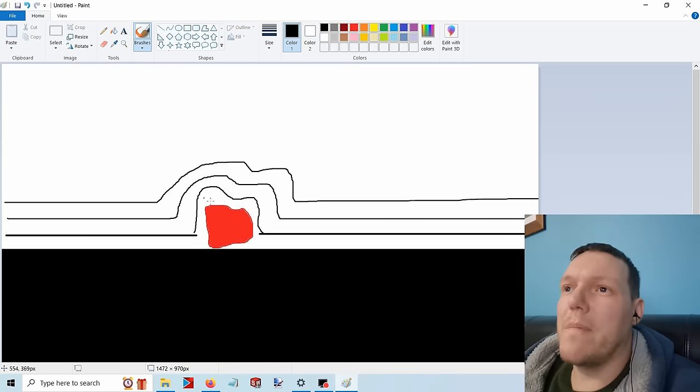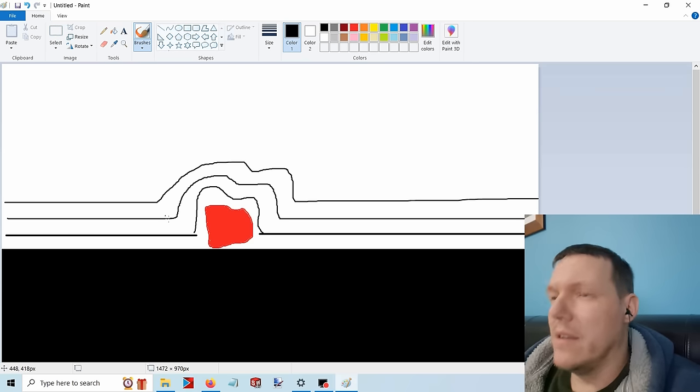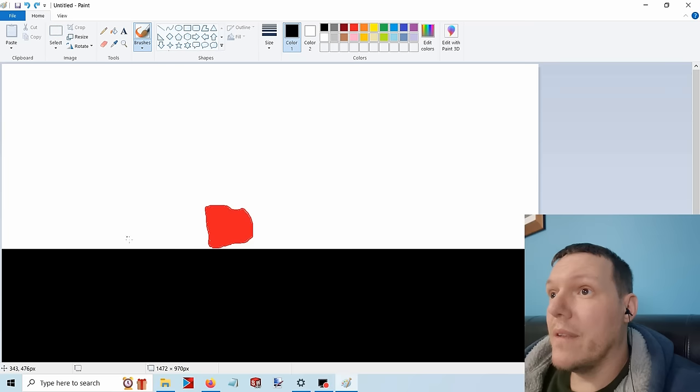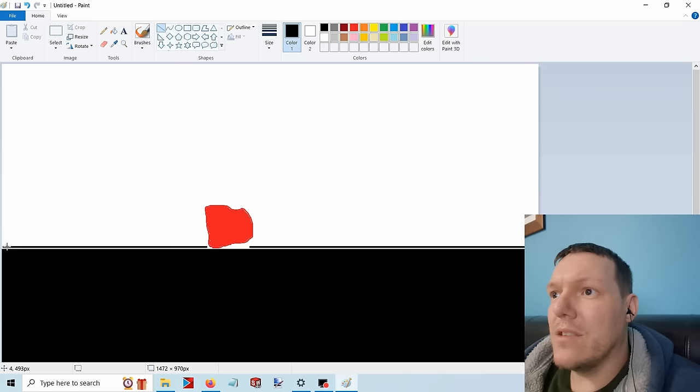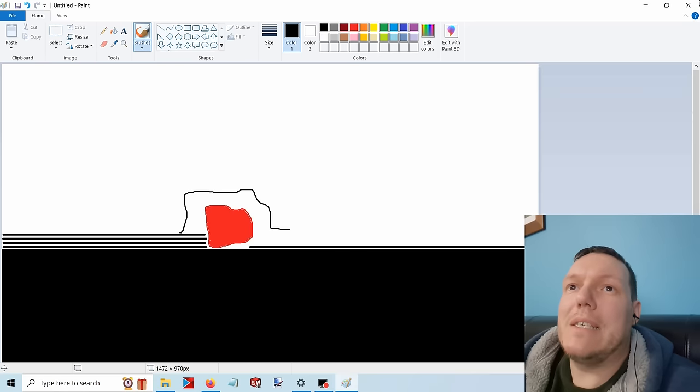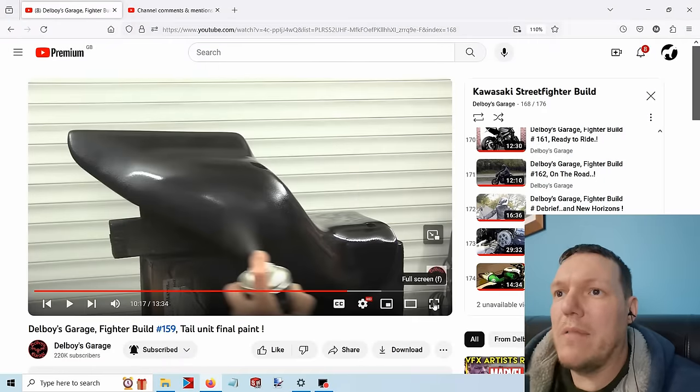But the problem with this idea is that more than 50% of this paint is the solvent and propellant that's in there, right? So what happens is that it shrinks. But the real problem is that the paint layer is this thick, all said and done. Right, it's really thin, and then there's another layer of it, and then another layer of it. And this is probably not even to scale. But you get what I mean? You put four layers on it, once it shrinks, it's like this. These are the layers. So your final layer with all these other layers on top of it is like that level. Well, I can see that, it's massive. So when it shrinks, it basically just stands out proud.